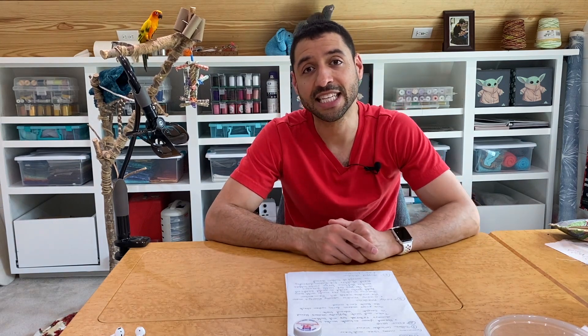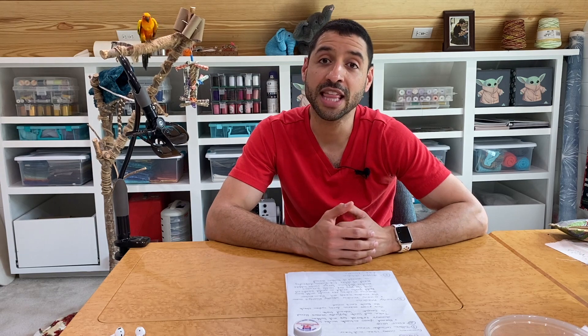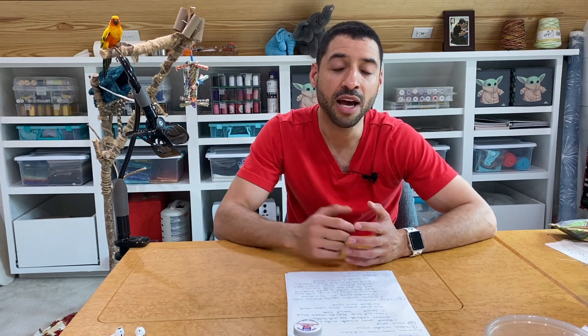The first thing I get telephone calls about all the time is when customers — especially new customers — turn on the machine and hear a humming or buzzing noise. I've had customers who've had machines for 8-10 years call me with this issue. What it is: it's your bobbin winder. On some machines, especially the new 4 series, when you engage the bobbin winder it will just start spinning, and your touchscreen does not display that you're winding a bobbin.